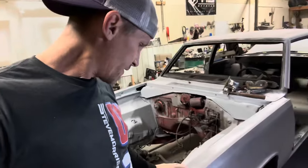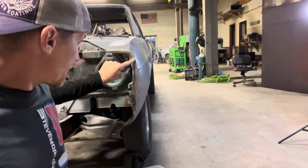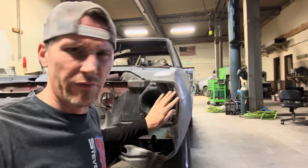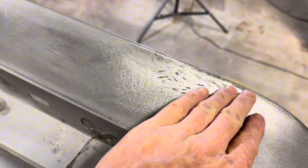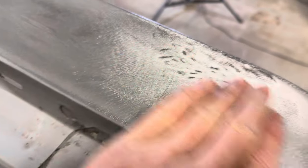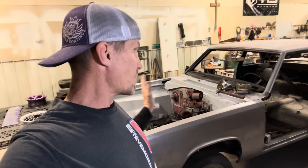Alan's got a lot of this already fixed up. Right here we had to do some welding — Alan had to pop this dent out, and there was a dent right along here. If you remember, there was actually some filler here from back in the day — old school. When Alan was knocking this out and getting it as straight as possible, he needed to weld this little spot. Right here were three little holes — possibly for trim or mirrors — and we've got them all taken care of. Any low spots he couldn't push or pull out, he's going to put a little bit of filler on, let it harden, sand it, and then do a light coat on the whole thing.